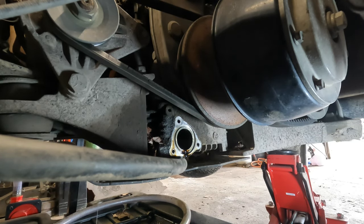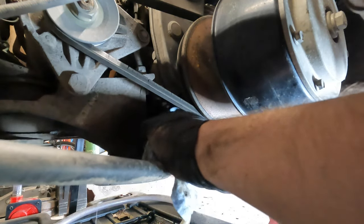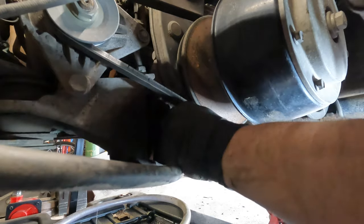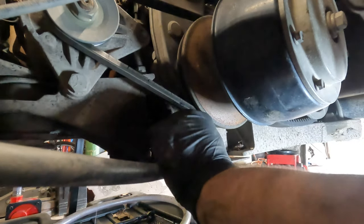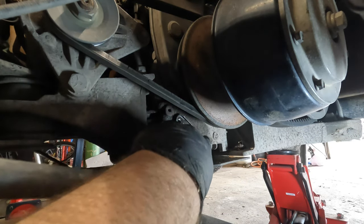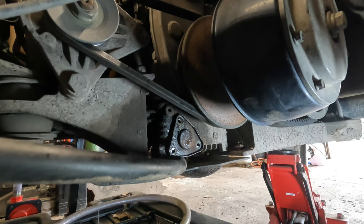All right, this O-ring is still good. Yeah, you could change it if you have one, but you don't necessarily have to, as long as they're not ripped and they sit back in their hole. Take some of that oil, just dribbling out of there, put it on. Now, the way these go on is the flat face faces forward. See how these have like a trapezoid or angle here and an angle here, and this side's flat? Right there. Flat forward. This is how I try to remember that. Well, I don't need to because I already know, but you know what I mean.